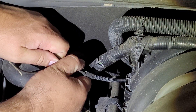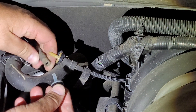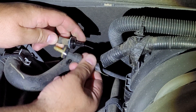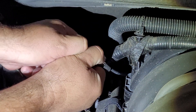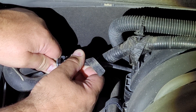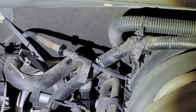Let's see if we can just pull it out. It's funny because I could hear all that vacuum leak off. Let's stick the new one on there. Always make sure it's oriented correctly. Pull that end out. We got our check valve installed.